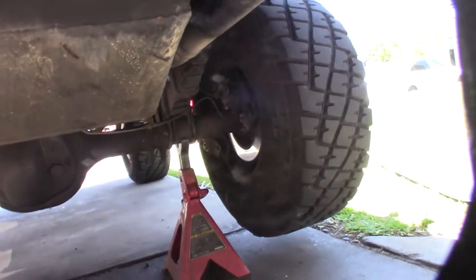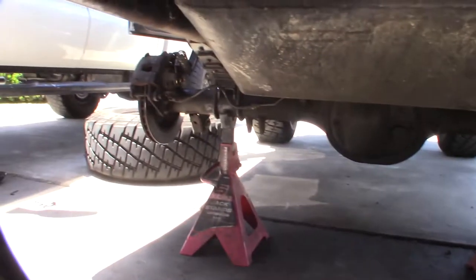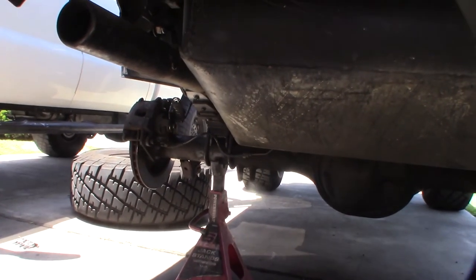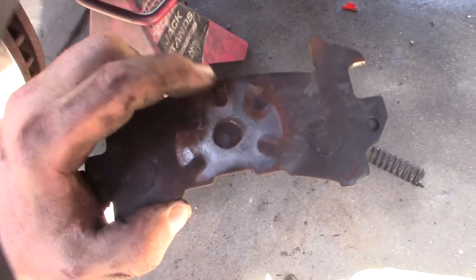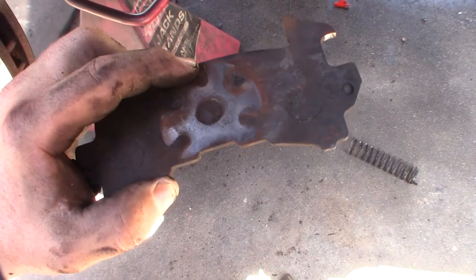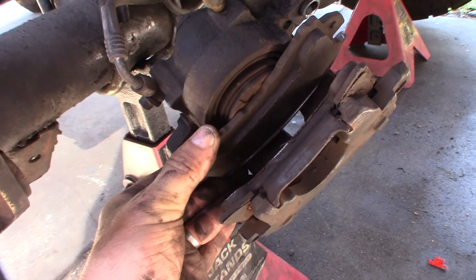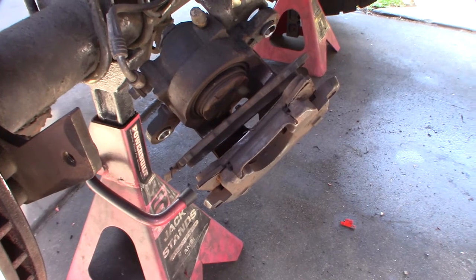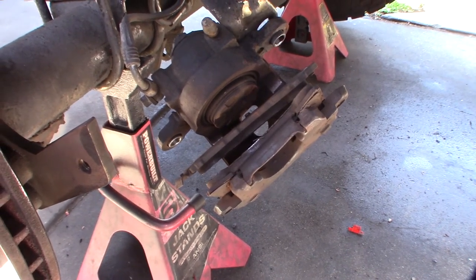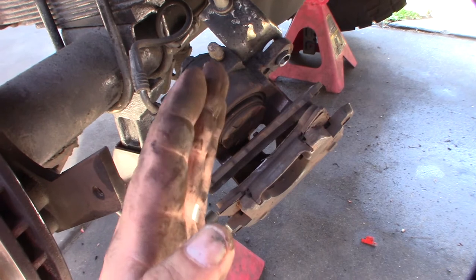That one's not even locked, but I think it's because I released the tension on that one. These are definitely a chore to figure out. See that little tab on the brake pad? It goes into one of these little notches on the piston, and that prevents the piston from spinning while the car's in operation. What I need to do is move one of these tabs — probably counterclockwise — to bring it out a bit more. The main thing is I want this to grab the rotor as soon as I pull the lever.